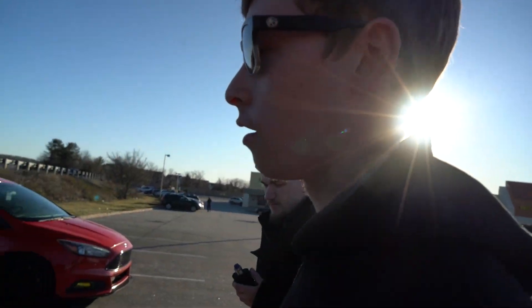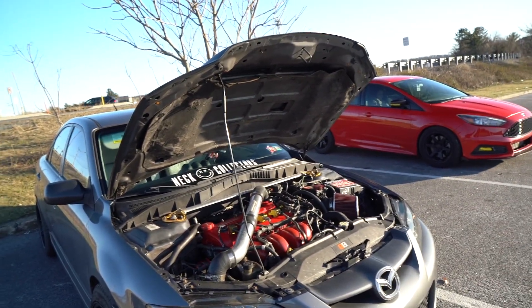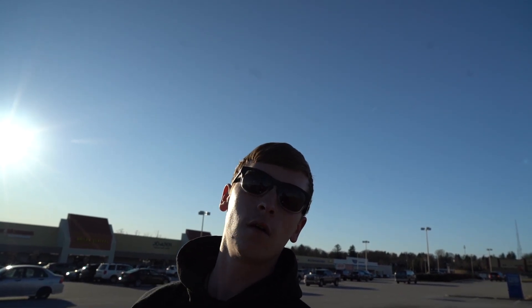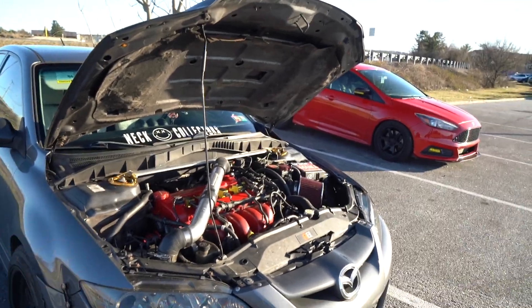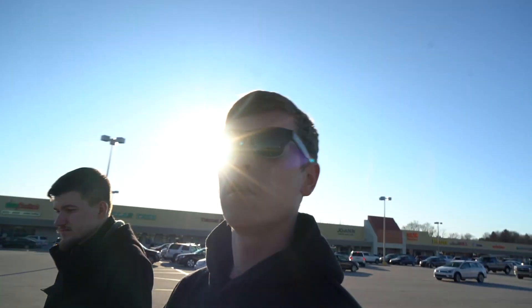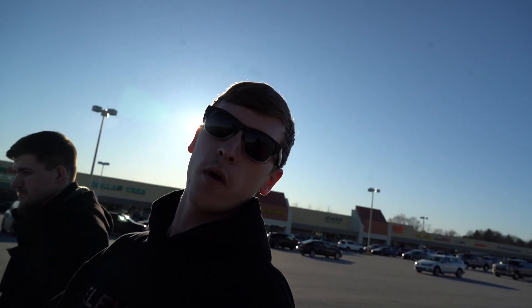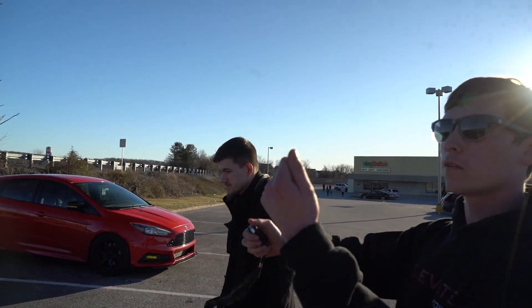The car shut off — that's a turbo timer. When you're beating the car hard, like we were doing at Cars and Coffee, and you turn it off, it allows your turbo to equalize to engine temp so your fins and turbo housing don't crack. It's tied right into the ignition switch. When you pull the key out, it keeps running. You can set the turbo timer from 30 seconds to 10 minutes, pull the key, and it just runs.